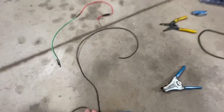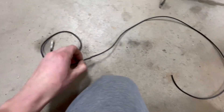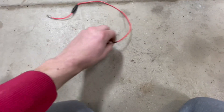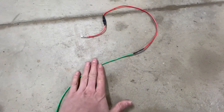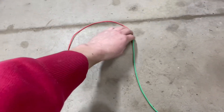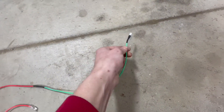So here's what I came up with. For the ground wire, I just found another black wire that was the same gauge, soldered it, and put some heat shrink on it, so now that one's longer and will be good. Over here, this one's a little different — the only gauge wire I had that was the same was a green one, because I didn't want to use black again. So I have the inline fuse, I soldered this, and I have a spade connector on it so I can plug it right into the fuse box.